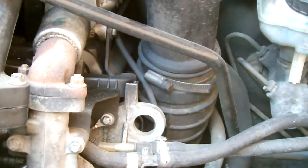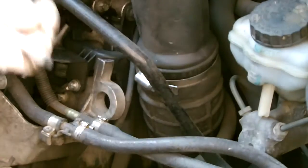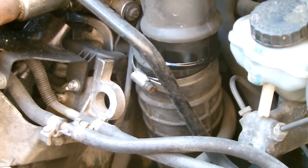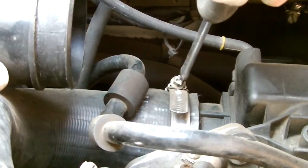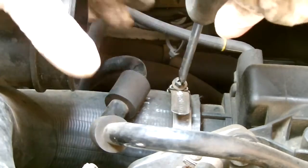This is the lower part of the intake and we're just going to open up this hose clamp as well — this comes apart pretty easily. At the back of this cross pipe — the one that goes across the top of the engine — you'll see a PCV valve, so just take that out as well, it just pulls out. Once you remove that top pipe, you can then get to another part of the intake system.